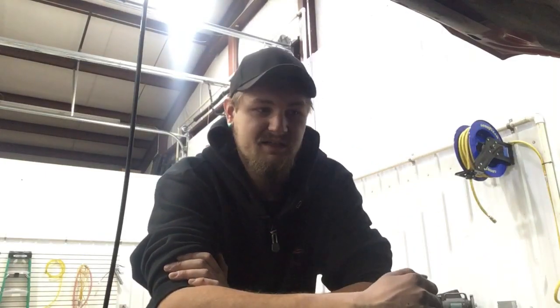I just pulled this motor apart and it actually wasn't too terribly bad for buildup, but there was quite a bit of oil in the intake when I first bought this truck. The reasoning behind this oil catch can is that the vent tube runs into one side of your oil catch can where it is baffled to drain the oil out, and then the air is allowed back out of the catch can and further into your intake. The point of this is basically just to help clean the air that's recirculating back into your intake so you're not burning that oil.